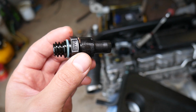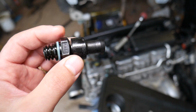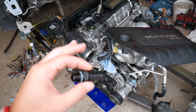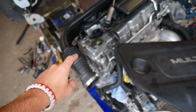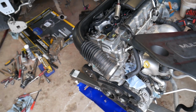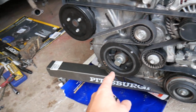One of them, guys, is being stuck closed, which means that it will not let gas pass through the valve, so the pressure in the engine will increase, guys, in the crankcase, and as a result, guys, you can develop oil leaks from the valve covers, from different O-rings, camshaft sensors, crankshaft sensors. Also, you can develop multiple leaks, guys.